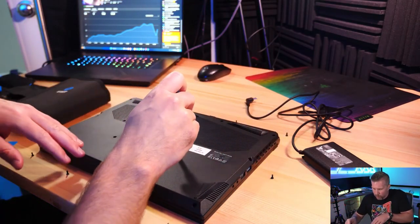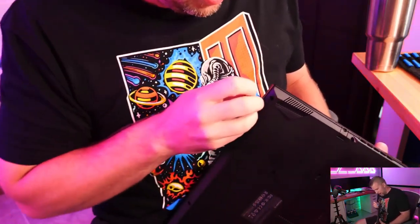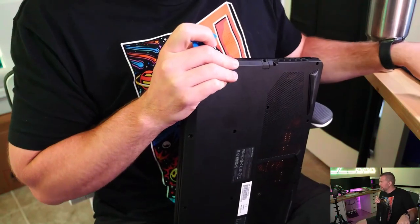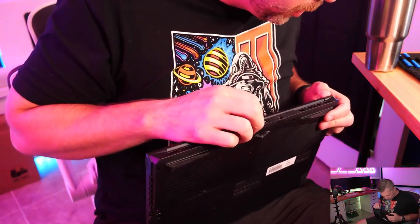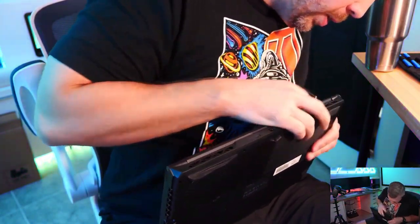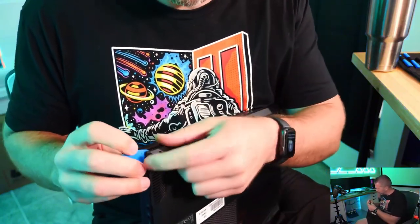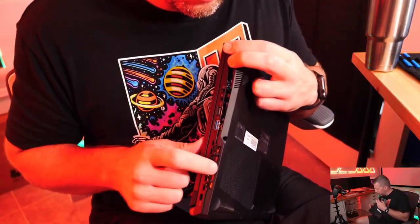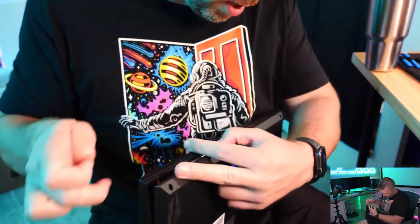I'm curious why they only limited this to 75 watts. I'm going to take the bottom panel off — to do that I usually use a picking tool or a separation prying tool. I use the iFixit toolkit, which there's a link to in the description. A little gap in the front right corner is a good starting point. To be clear, you don't want to start from the back — you've got to start from the front of this laptop if you want to take it apart.